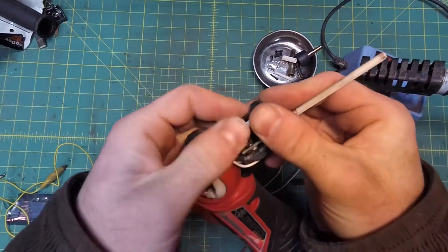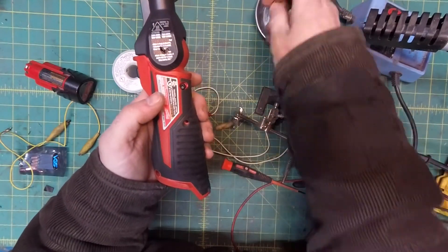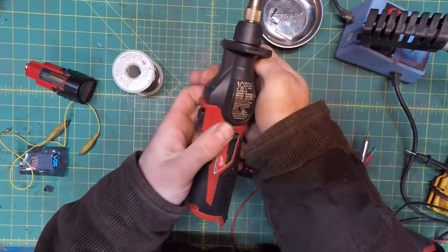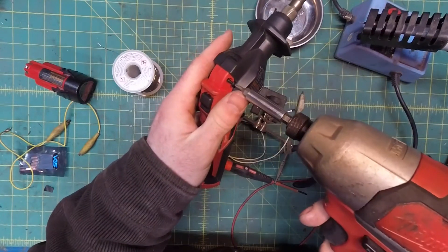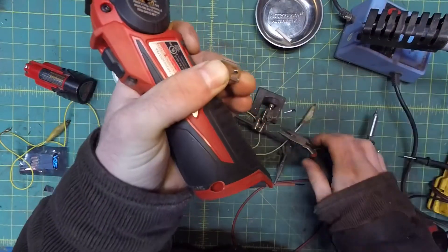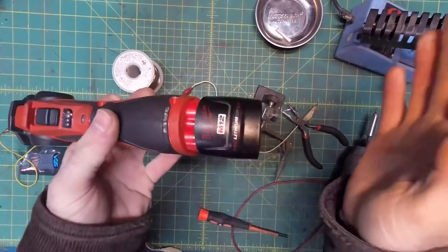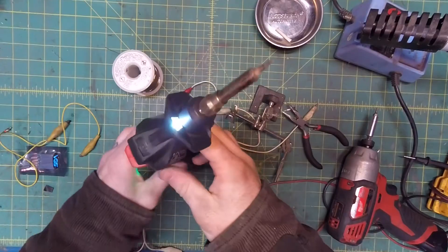Put the LED back in. Why didn't you just send it back under warranty? Because I am the warranty man. By the way, take note: this screw that goes into the sticker right here is longer than the others — sneaky Pete. Bend this little tab back down so it can actually do its job, and pop it right back in. I'll include a link to the fuses I used in the description as well as a link to a replacement heating element if you find out that's your problem.